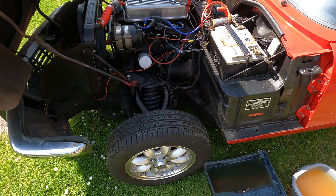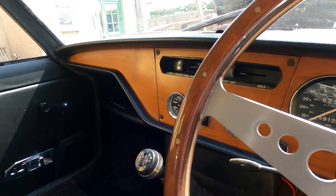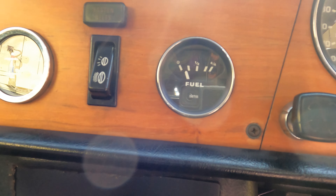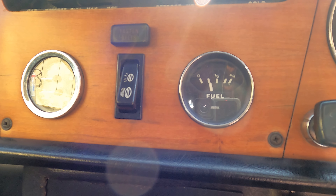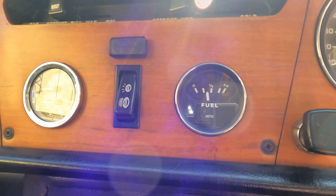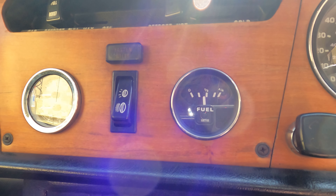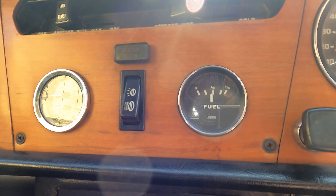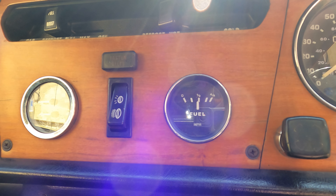I've put the battery back on, put the key in the ignition — let's see what the gauge reads. The ignition is on, just waiting for the fuel gauge to come up. You can see it's rising — just over a quarter, which is strange because there's no fuel in the tank. Very odd. The gauge is pretty new, and I can see the voltage going up to nearly half a tank now.